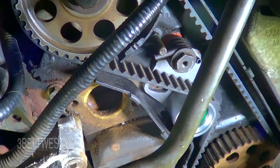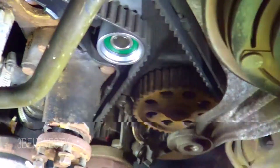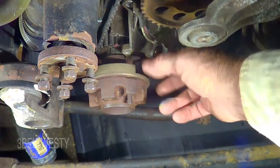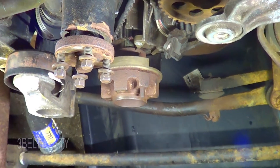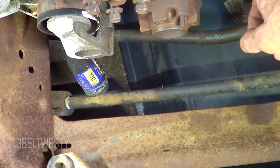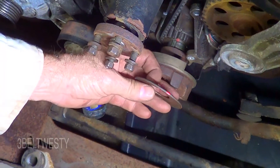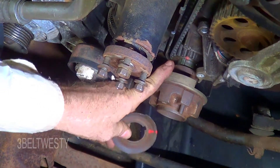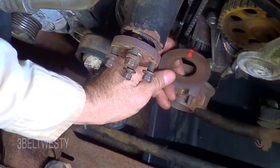I'm going to do it just because that's the way Ford did it when I had this done at the Ford dealer — not sure if they were using it as a cheap Loctite or what. There's a new tensioner with the old spring, and the belt is on. I've got to bolt the bracket back in and adjust the gap on the hall sensor — that's the crank position sensor. This is on a '94. The '95 has a different hub, a different sensor, a bunch of slots, and the cover is different on the '95. This belt guard piece goes between the hub and the sprocket.